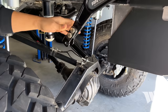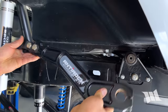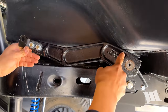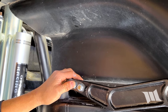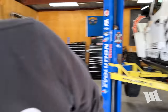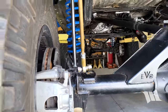At full droop, it just wasn't long enough to reach the axle. Now, being that this arm is dog-eared like this, there was a thought that maybe we could just flip it over. Going up, you can see it immediately makes contact with the fender, so we can't even get any travel whatsoever. And then the other problem is, even at full droop, this point to this point is exactly the same — still missing the axle by about the same amount of distance. Nothing changes.